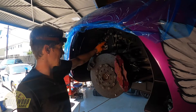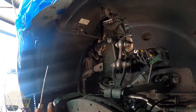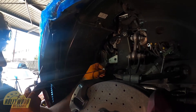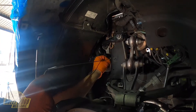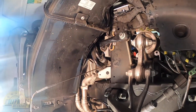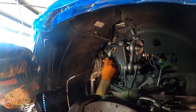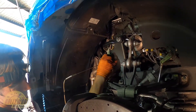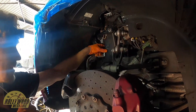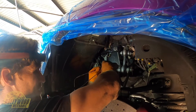You don't have to remove this clip on the Aventador S — it's a major pain to remove because of the oil cooler here. When you pull it out, pull the 12 mil probe before you pull the 14 mil. The 12 mil has enough space to fit in with the 14 mil probe still there. It's the same when you reinstall — you're going to put the 14 mil probe in first. And then fit the 12 mil through there as well.